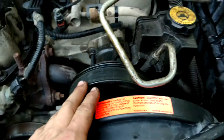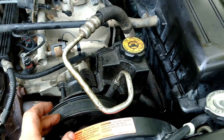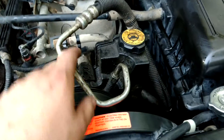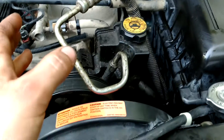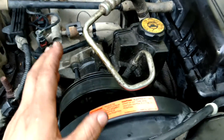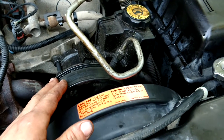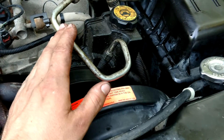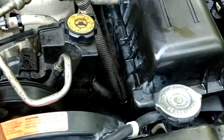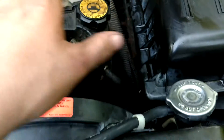Now in this case, this is a power steering pump off a '96 Jeep Grand Cherokee. You can see here this line — this is also the main pressure line. The power steering pump itself is actually the same, but the only difference is that this pulley is bigger, about half an inch in diameter. And this main pressure line is bent differently, so it actually sticks up farther — it's supposed to be flat and run this way. But luckily, everything fits in the same way.